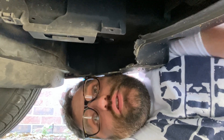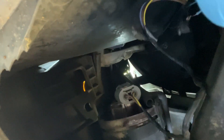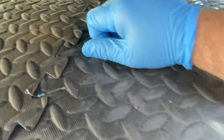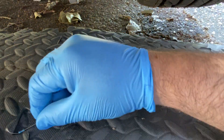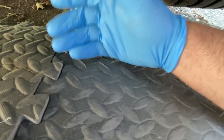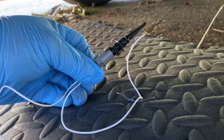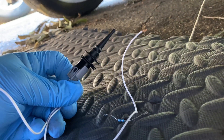This is gonna be a little different than you would normally see because there's some curb damage down here, and there should be a cover there but there's not. The spot we're working on is right here. Don't mind this resistor — I had set that in there just to test whether those wires were the correct ones. We put that resistor in line and it changed the temperature on the readout inside, which told us that is in fact the wiring for the ambient air temperature sensor. Now that we have the actual sensor, we can put it in and it'll give us the right temperature.